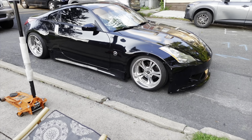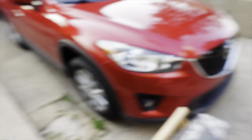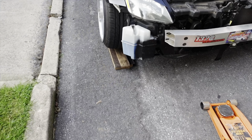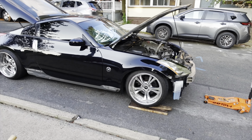I'm going to go ahead and take this front bumper off so I can jack it up from the front, put some jack stands on, and take off these wheels so we can get ready for this install. So progress — we've got the side skirts off, both of them over there. We've got the front bumper off. The car is moved up and on two blocks of wood so I can actually slide the jack under. I'm going to jack it up, put it on jack stands, put a chock on there, take the wheels off, and get ready to rock and roll.